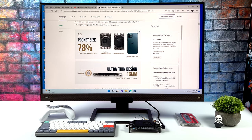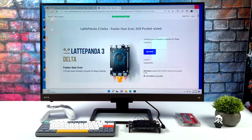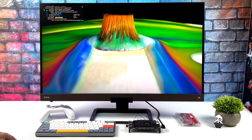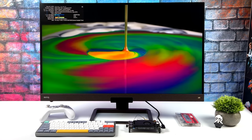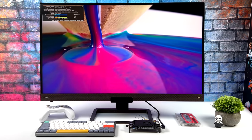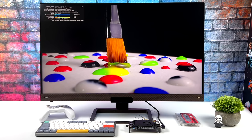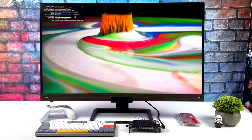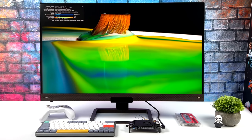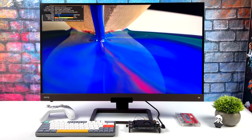I wanted to check out 4K video playback, so from YouTube I ran a 4K 60fps demo video with Stats for Nerds in the top left corner. By the end of it I had eight dropped frames, which is something you'd never notice unless you had Stats for Nerds on screen. Overall this little chip does handle 4K. I tested the same chip in another mini PC with dual channel RAM and got zero dropped frames, so I really think it comes down to the single channel RAM setup.